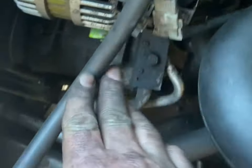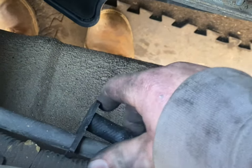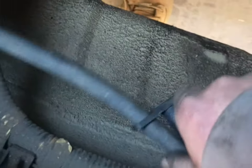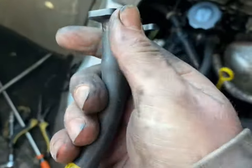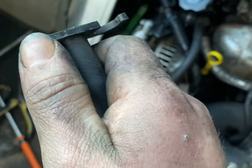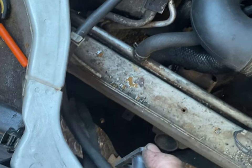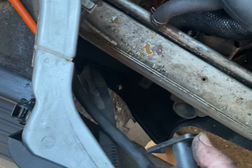Under the passenger seat again — see this hose? This is the bleed pipe for the cooling system. I'll take this off. It's the bleed pipe — that's the bung that needs to come off. It's not easy to get off, but with some grips and a bit of leverage that will come off.